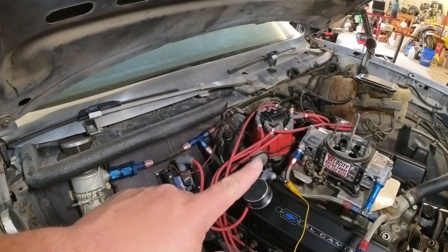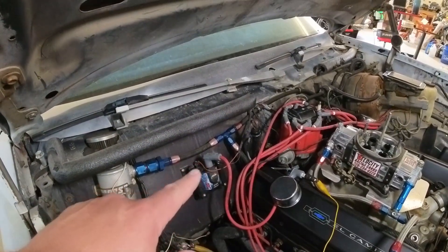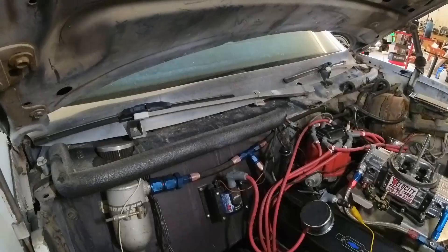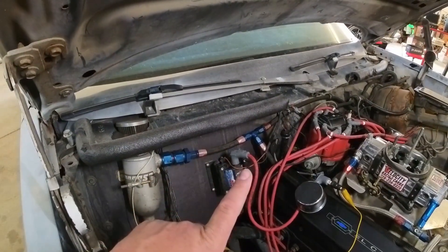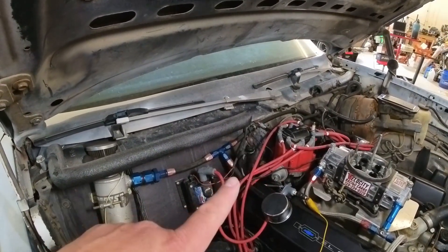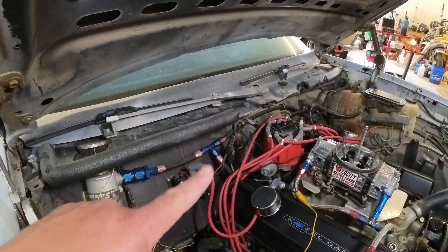Before I show you how to jump that, it is worth noting that the coil is not necessarily an uncommon failure point. I did swap off my Pertronix Flamethrower coil for another coil from the '64 Buick — it's just an MSD Blaster 3 coil. I did not have spark when I performed this test the first time, but I also forgot to turn the key on to do it. So I'm doing it again and I have spark.